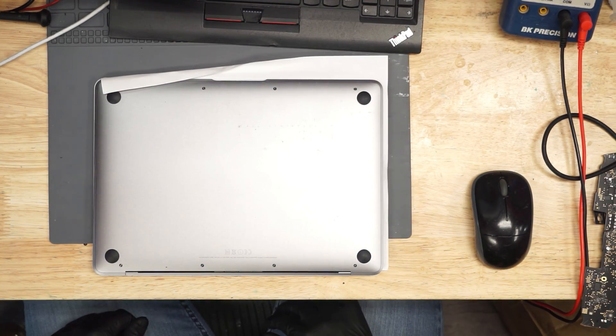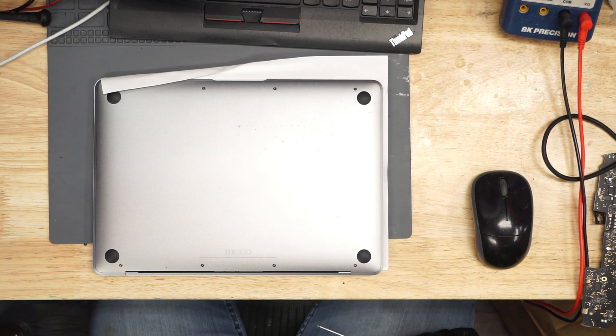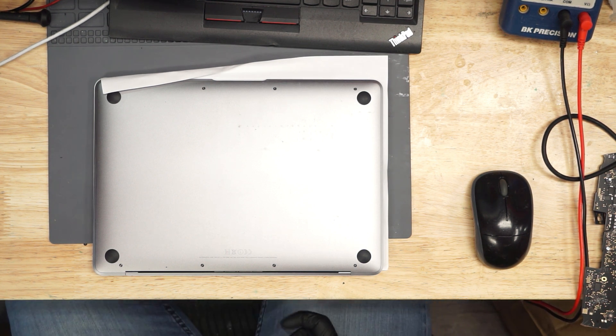We're going to open and fix another MacBook. This is a 12-inch MacBook, one of my least favorite of all the MacBooks, but one of Paul's favorites. The most common issue with this MacBook is that the CPU will be dead. It'll take standard startup voltage, it'll boot up with no video, no chime, no nothing.